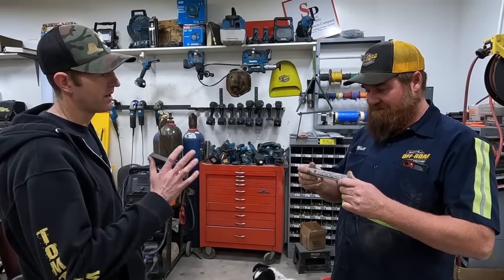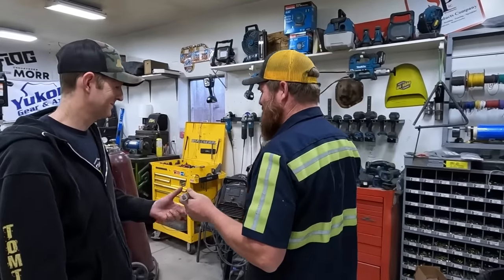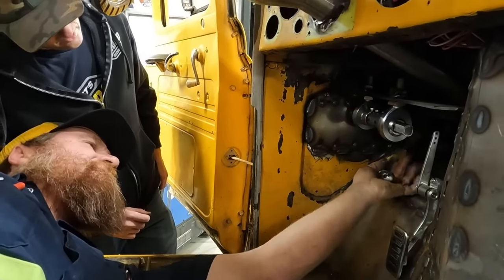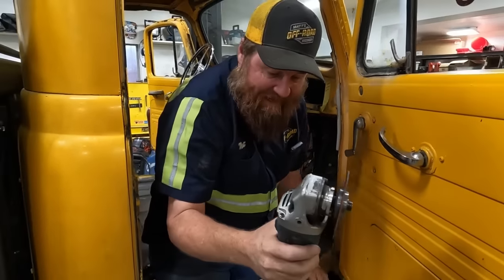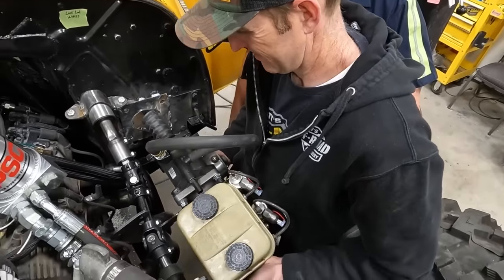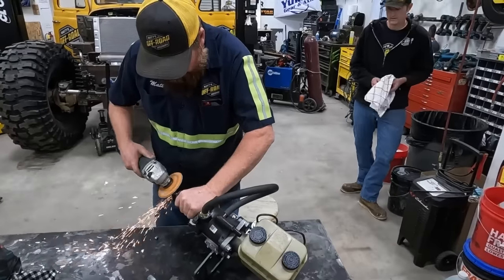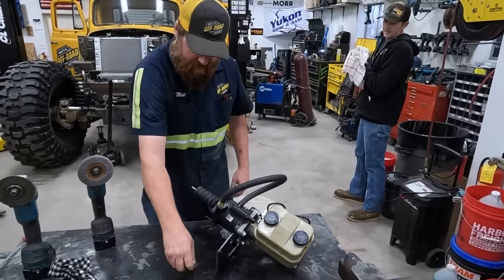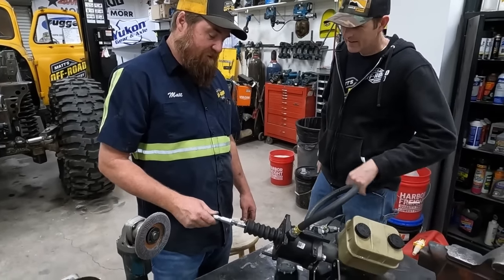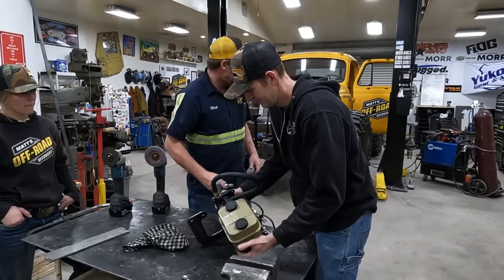Let's bolt it in there and see where the brake pedal needs to line up. They kind of walk different ways but when I line it up they all look like they'll grab something. It's close-ish — I think we're going to need to cut about a half inch off of that. We'll keep this from rattling by putting JB Weld in there, same thing we did on the Morvair. Works great — just make sure not to put too much in because it'll all squish out.